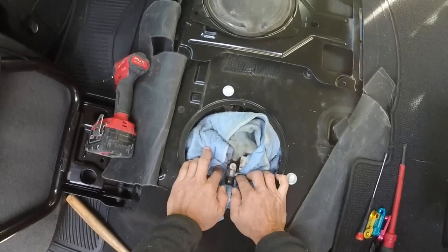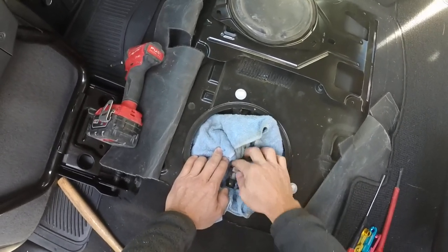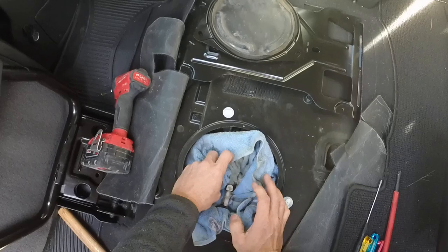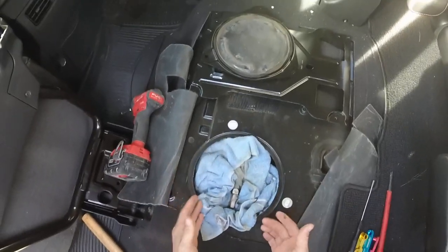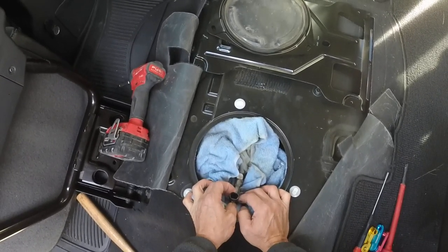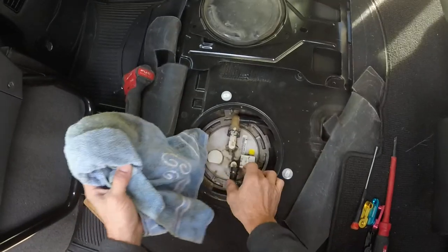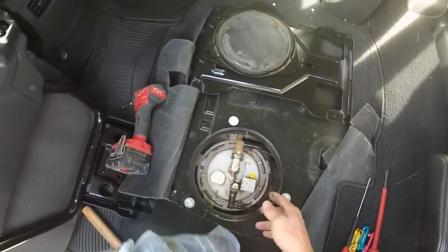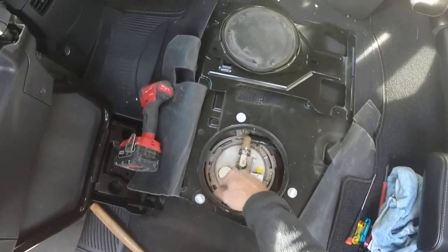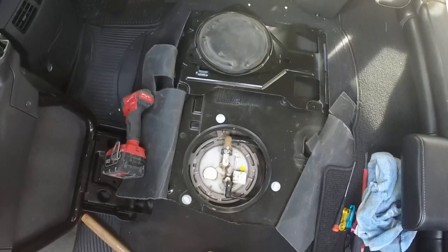As you can see, not much pressure, and this has been sitting overnight. Whatever the little valve is that keeps the pressure in the lines is just not working very well, and the pump's not priming well either. When I turned the key on earlier it didn't prime much at all. If yours is really dirty, maybe get an air compressor or blast it with a hose — it's okay to get wet, there's a seal here. Just clean it down real well; you don't want debris falling in your tank.